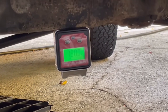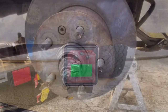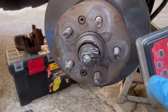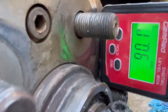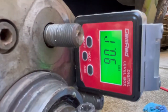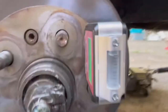That's 180 — the beam is now exactly level with earth. Now I'll take the same level and attach it to the hub out here. You'll see it showing 90.1 — that's 90.1 degrees away from level ground.